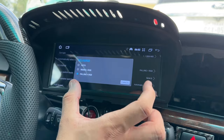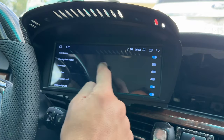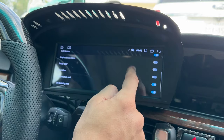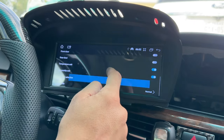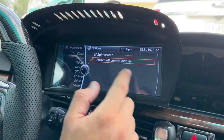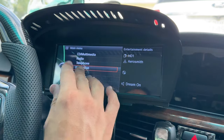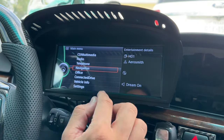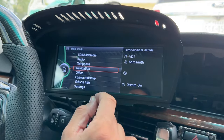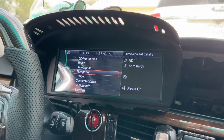From the factory settings menu, this is where you format the iDrive menu. Click 'automatically select' and it will automatically adjust the resolution to 1280 by 480. Go to RGB and make sure you click 'falling plus RGB' because it is perfectly normal for the iDrive menu to look completely butchered out of the box. You also have door status you can toggle, full screen option, and many other options to enable and disable. Once configured, the iDrive menu will look OEM, factory, and high resolution.